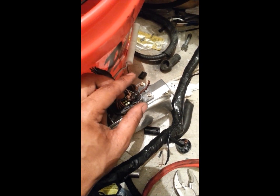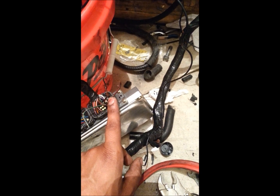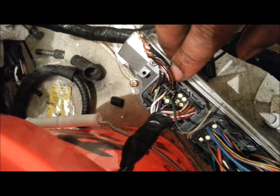I'm going to plug this to the positive on the battery — this one also. These three at the bottom all go to the positive of the battery: this is the ignition switch wire, this is plus B, this is plus B1, and this is the battery wire. I connect all three together and connect them with F6 from the loom plug and to the positive for the battery. I connect F6 with the top ignition switch wire and the three bottom wires: battery, plus B1, and plus B.